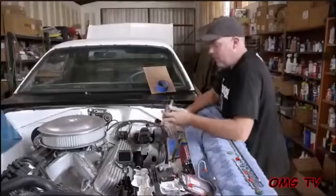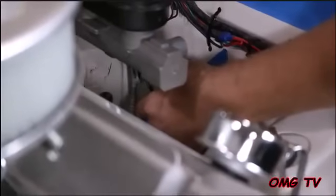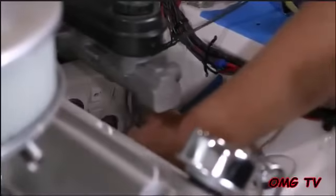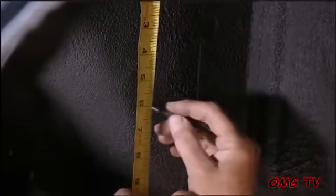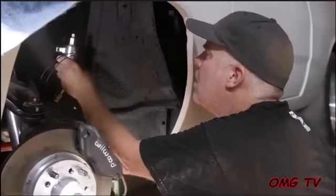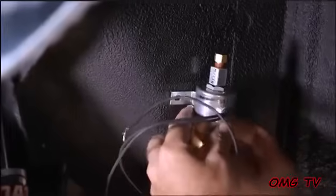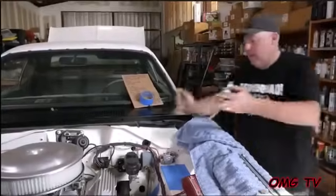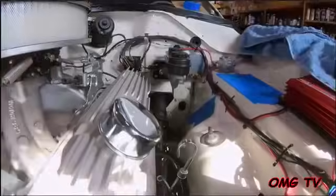I think I've made a decision, which is at least 50% of this job. The problem is I'm going to mount my roll control down here but I can't get a drill motor in there — we don't have a 90-degree drill motor. I'm going to line it up with this factory-stamped hole I can see from the other side so I can hopefully get this thing level. Let's see if I got it straight — if I eyeball it, that seems good enough. Now I have to hog those holes out, bolt this in lightly, and then figure out if I can make those brake lines go out to the wheels.